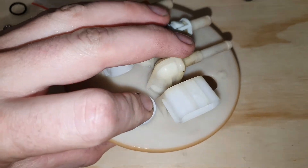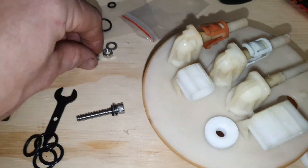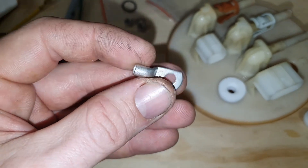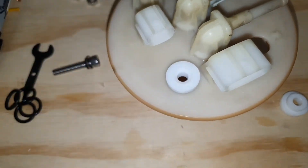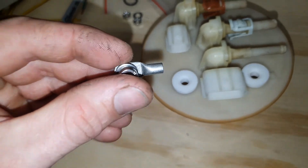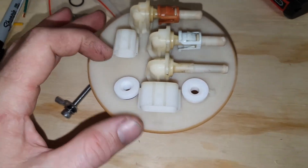I've drilled two really clean holes going straight through the fuel top hat. Once you get the fittings on both sides, you put the bolt through and that holds these crimp terminals that I've got here. I'll hard wire the fuel pump straight through the hat through the electrical connection. Once I've got the wire crimped onto the terminal, it'll look something like this - I'll show you what it looks like once it's all fitted. Pretty easy to do, but you have to be careful.